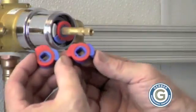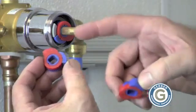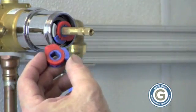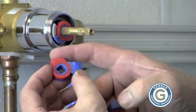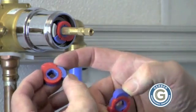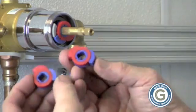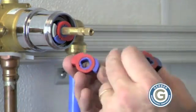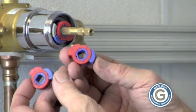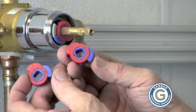Here's a quick easy way to see what I've done by changing the temperature limiter. In my left hand you'll see the temperature limiter as it comes to you out of the box, where the red part — which is the stop — the tail piece is right up against the blue. In my right hand, after the adjustment, you can see that the red piece, the temperature limiter, is advanced more counter-clockwise by about seven or eight teeth on the red gear.